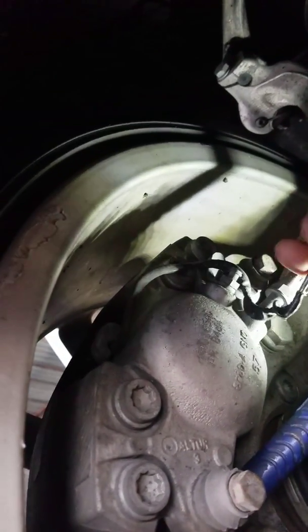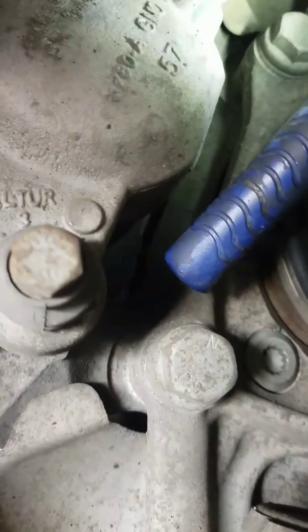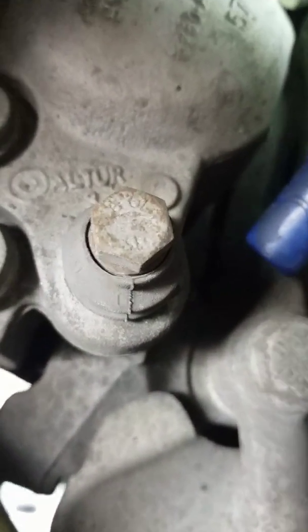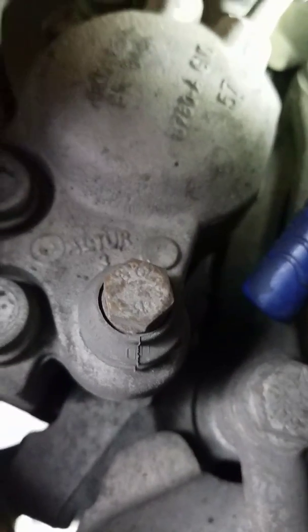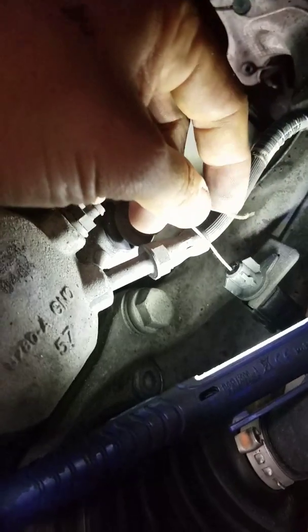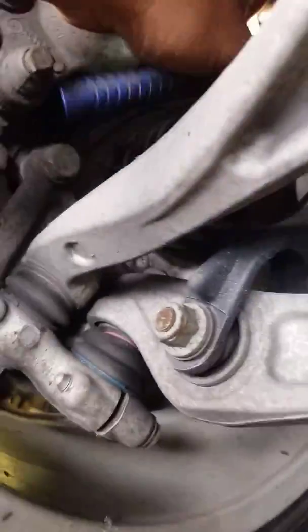You see, I can rip this up for you, but I think we found our problem, guys. This is our problem. It's hard to work with one hand. Not sure if you can see what I'm doing. Alright, there's your problem. See that one wire? It should be connected there. So, that broken wire could cause a brake light to turn on.